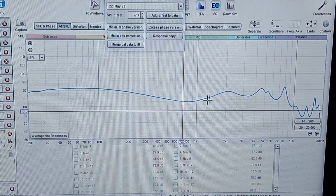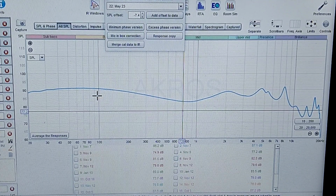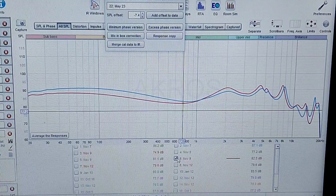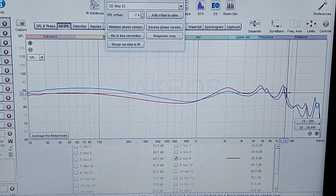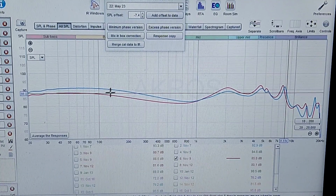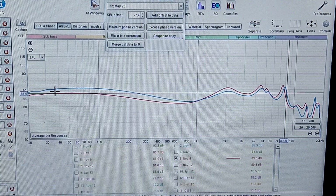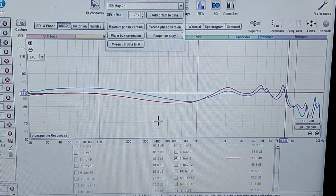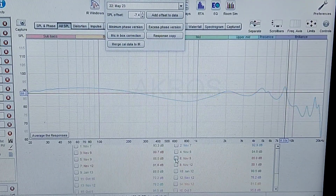But now, it's this that is an absolute mess. What is this, people? Please, what is this? So, basically, I did a little mod to it, and this is just the coupler, so I didn't introduce it 100%. But we're talking about a difference of 4 dB here, a reduction in the mid bass. It's now much flatter. There's no bleed into the mids that's really noticeable. It's got a slightly higher pinna gain, as you can see, and the mids basically just follow through the way they are. Much nicer sound. This is what it should have been, because it's still got plenty of bass. Anyway, this is the stock one.